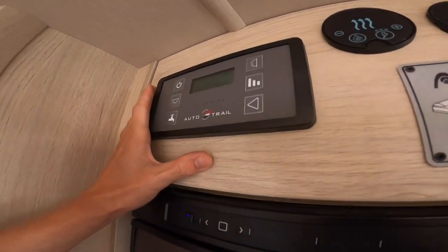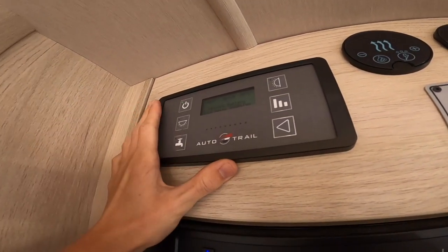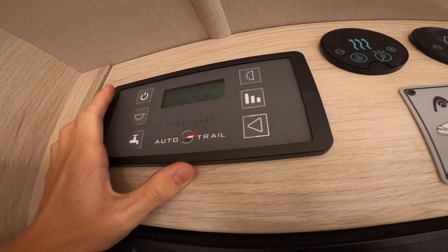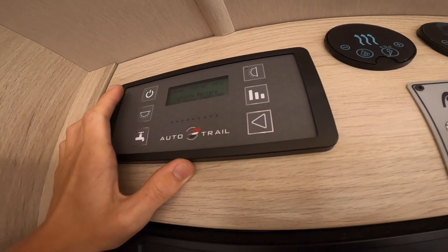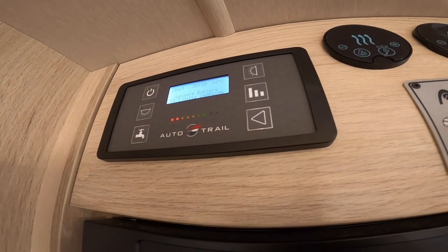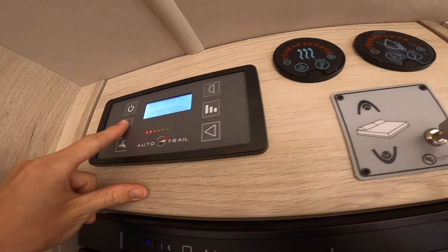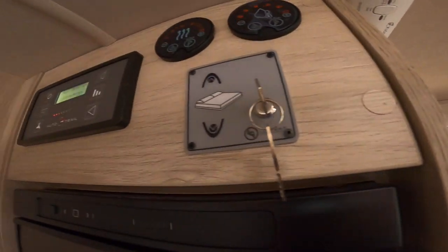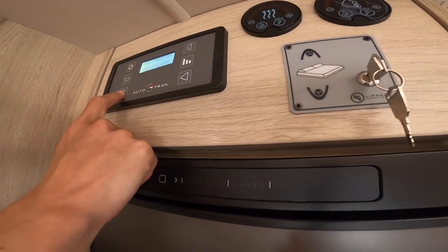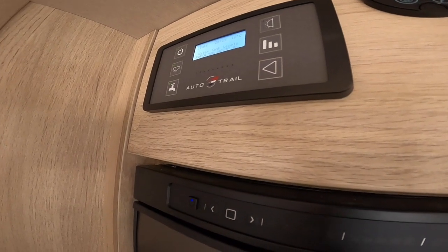So when you come in the vehicle, above the fridge is all your 12 volt control panel. If you're hooked up, you will have mains electric, which will work all 3-pin plugs. Should you not, you'll just be using your 12 volt off your leisure battery. So you turn the vehicle on and off at the top. And then below, you've got your master switch for all your lights, which are then individually switched. And below the light switch, you have the pump. Should you be using the tap, the toilet or the shower, you must put this on as this pressurizes the water.